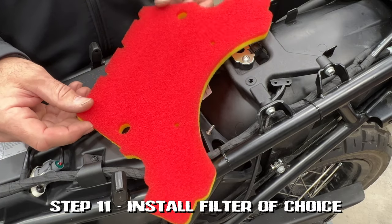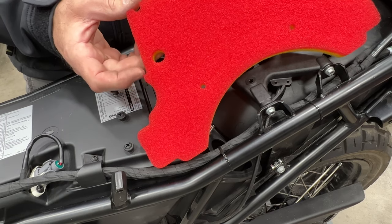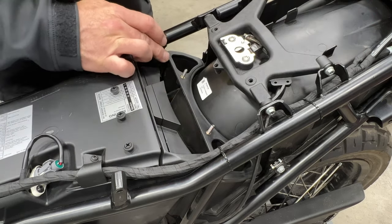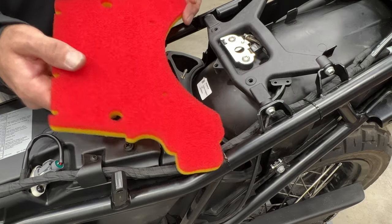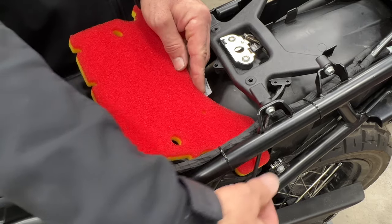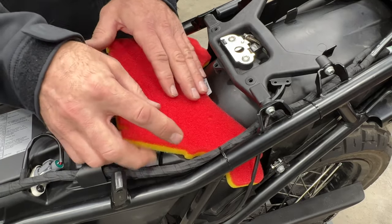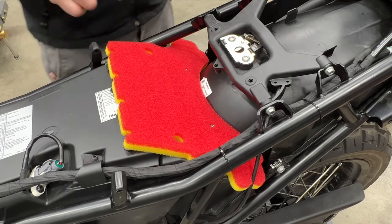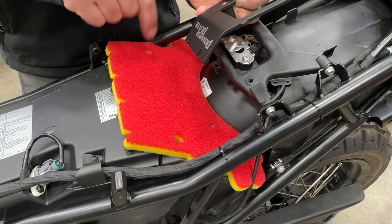Alright, now we're at the final stages of this install. The first thing I'm going to tell you is that these air filters are not symmetrical — they are actually side-specific. The indicator is going to be this little point right here that's on the left-hand side of the bike, because the stock airbox is not symmetrical. These tabs right here are designed so that once you get them through the frame, you have something to pull on and get it in place. So put the filter in and get the studs through the two small holes in the filters. These two holes are designed so that the plastic bumpers on the power plate frames can hold the stock air filter down and keep it from coming out.